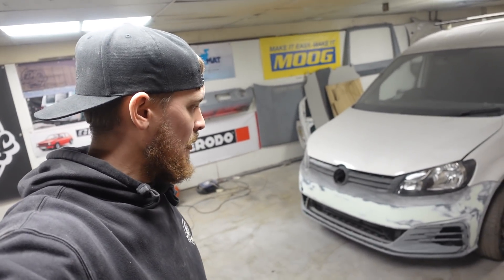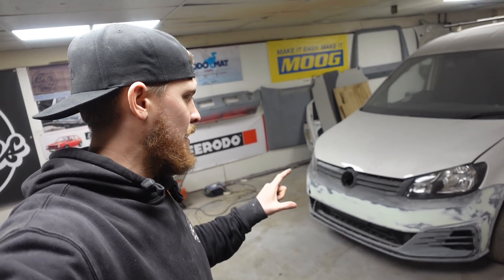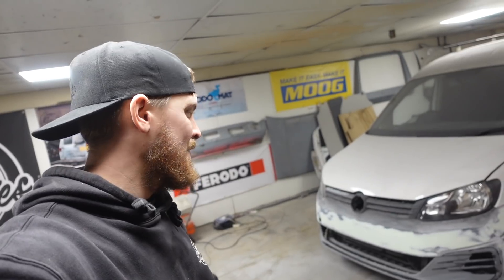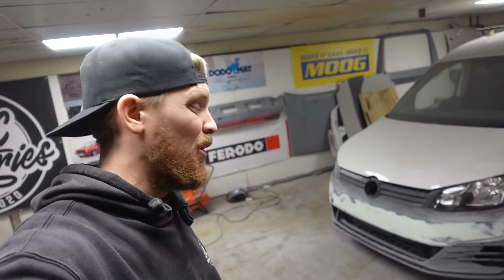It's had three or four goes with the SMC carbon fiber filler for deep gouges, scratches, and joints. Then it's had two, maybe three goes with the Dolphin Glaze. To clarify — it had one big coat of the SMC and then where bits were low I put more on, and the same with the Dolphin: one good coating over the whole thing, sanded that back, then where it was a little bit low I put more on as well. It looks a mess because it's all different colours, but it feels pretty nice with good transitions.